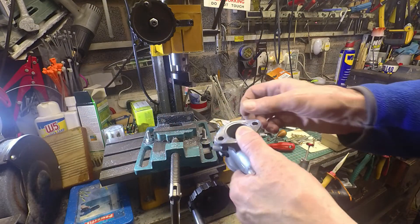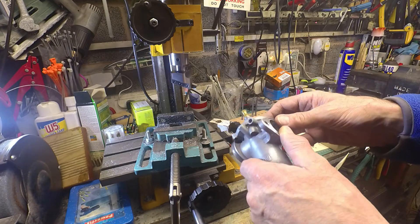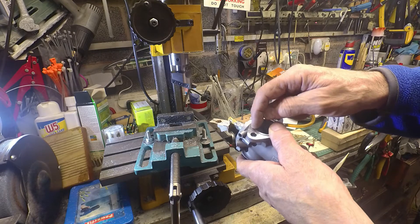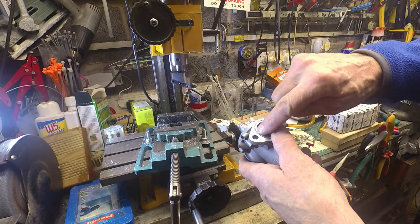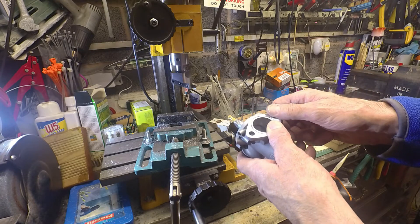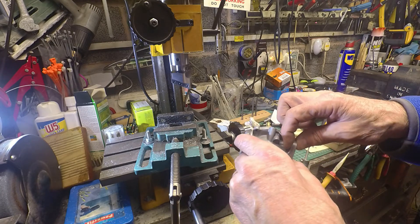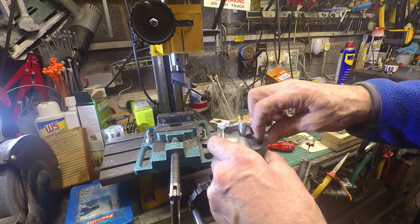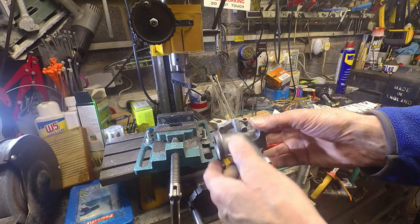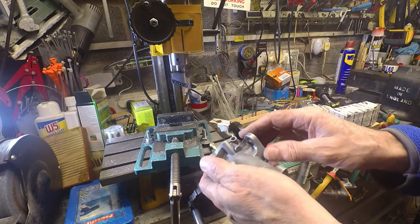Not too bad. This machine is far from accurate, but it looks okay. The O-ring groove is going to be slightly shallower now, certainly on either side where the ears are, less so in the middle — I could only just skim that surface. It was just over 16 thou removed, so not too much thickness lost. I really don't like the idea of taking metal off, but needs must in this case. I'll put it through the ultrasonic cleaner, blow it through, and give it a try.